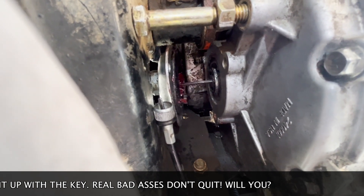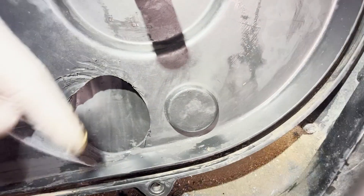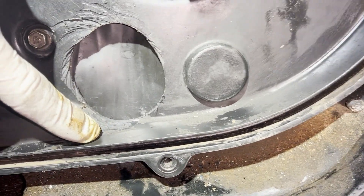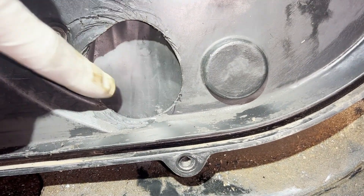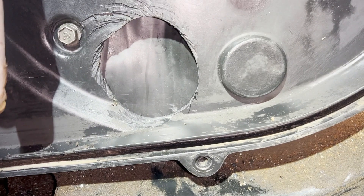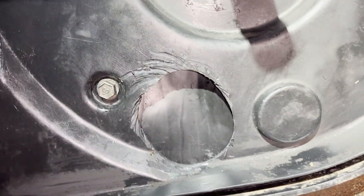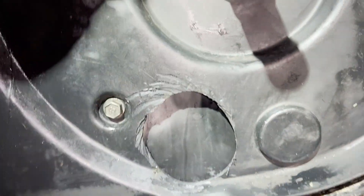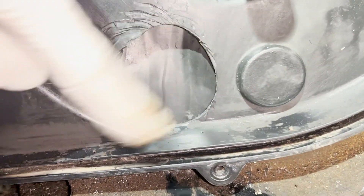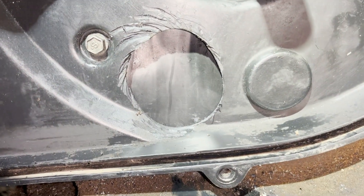I'm not going to be able to — I need both hands. So I'm going to set this down. And as Shania Twain would say, whatever. Take the flex seal with the sticky side facing the engine and slide it between the plastic and the frame. Now I'm going to go on the other side, cut another piece, and slide it up in between the speedometer unit and the frame, with the sticky side facing outwards, so it'll push against this sticky side. And that flex seal, once it grabs a hold, it ain't going to go. This way there's nothing inside here, so in the event that the flex seal did let go, it won't get hung up in the belt. It's going to be just fine.